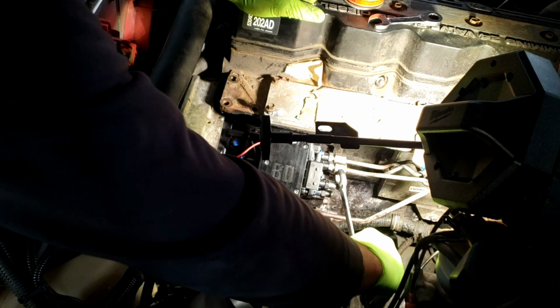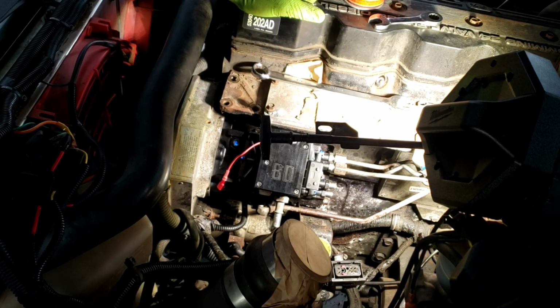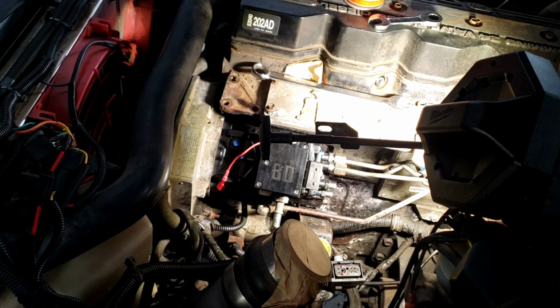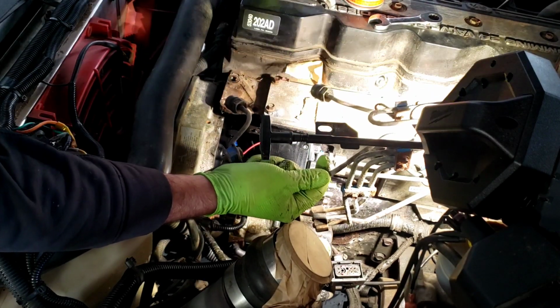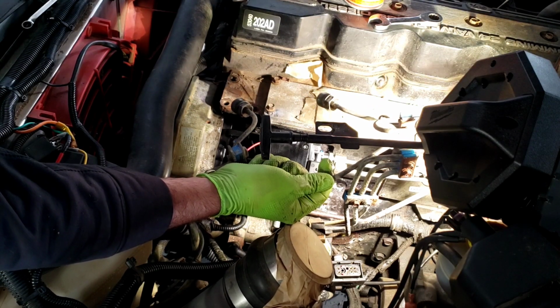Some people might comment on the way that I tighten these fittings up, but I tighten them, loosen them, then tighten them back up again. So take these. I do try to keep the ends of them pretty cleaned up. I pulled the tape off of them. The injector lines themselves, they're starting to look a little rough though. But that's all right. Need to clean my tools up.